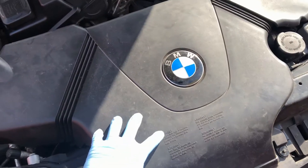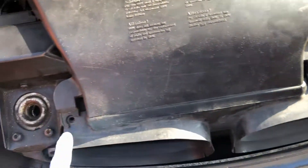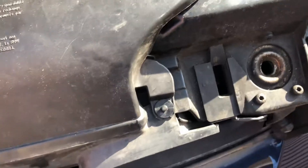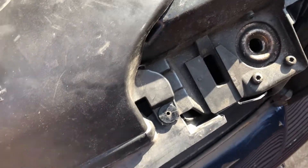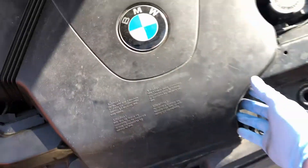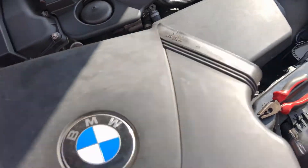The first step is to remove this large piece of plastic ducting. It's attached at the front with two plastic clips — one here, and the other one has snapped off. It also attaches down by the washer bottle but that's broken too. So we're going to come in here and with a pair of pliers just pull that clip out and remove the centre part of it. That allows us to pop it out, remove the rest of the clip, and then this whole piece of ducting pops out from the front and slides out from the air box.